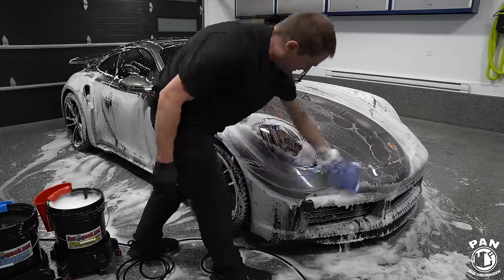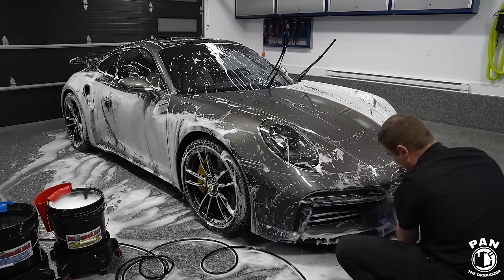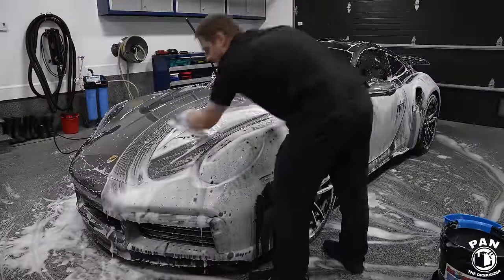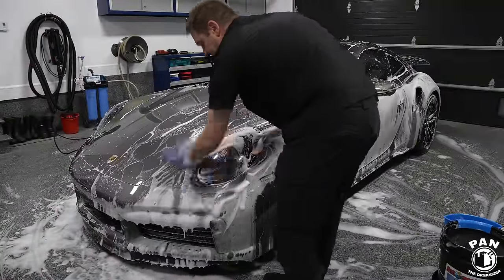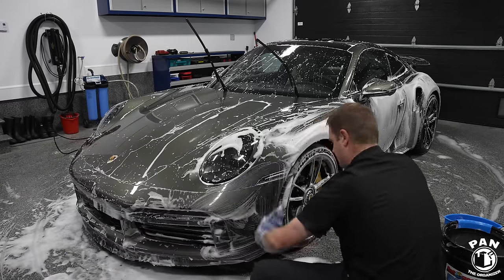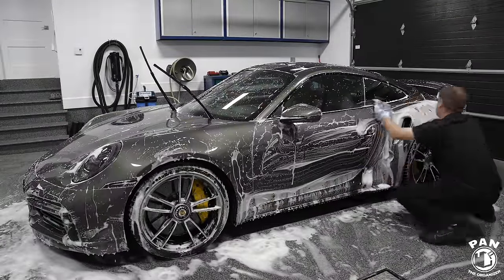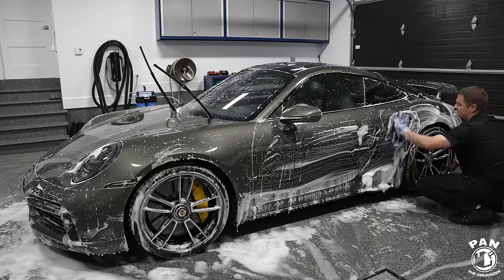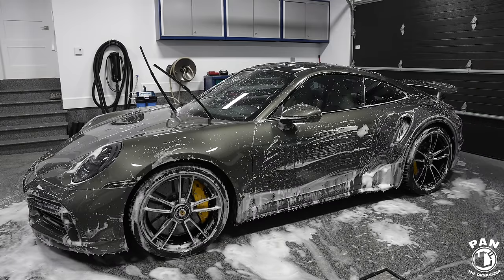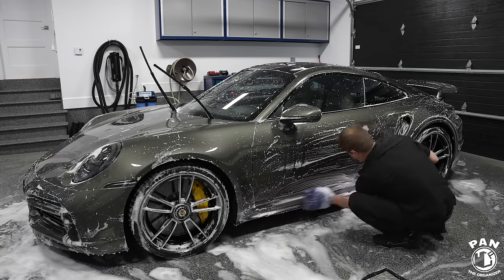I featured that in my beginner's car wash kit tutorial. But if you have a coating, CarPro Reset is fantastic — you can use it in your foam cannon for the pre-wash stage and in your bucket for the contact wash. We're not looking for acidic shampoos like CarPro D-Scale for mineral deposit removal, or Bilt Hamber Auto Foam, or CarPro Lift — those higher alkaline snow foams are for deeper cleaning during pre-wash. This is just a pH neutral soap for your regular weekly washes. No gloss boosters, no additives, no ceramic components, no waxes — just a pure shampoo.